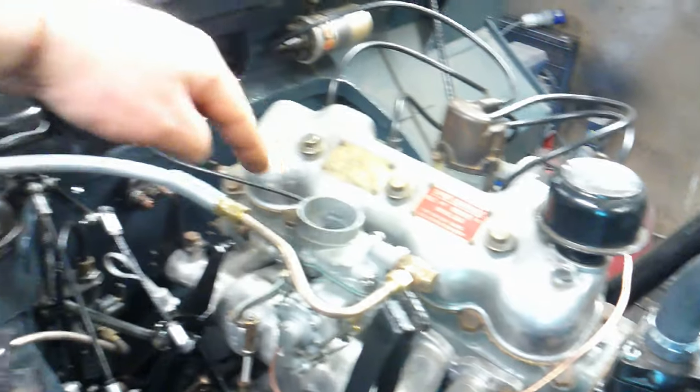Bolted this plate down — it's all bolted in. I've just painted the air filter. There's the air filter — once that's dried, it stands there and a little hose just goes round and connects onto the carb. I'm just putting this bonnet strip on. See the holes underneath — just drill a little hole in this with your drill, and then you have these slightly split pins — push them through and then with a pair of pliers just open them up at the back. I'm not going to cut this yet until I put the wings on.